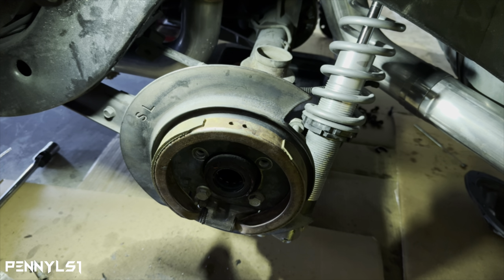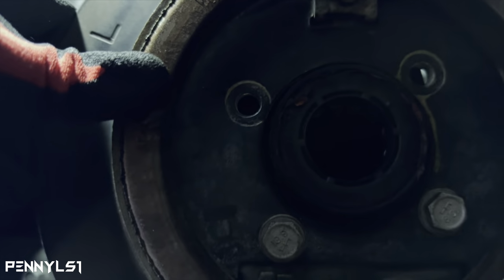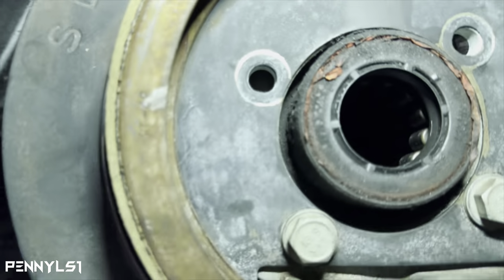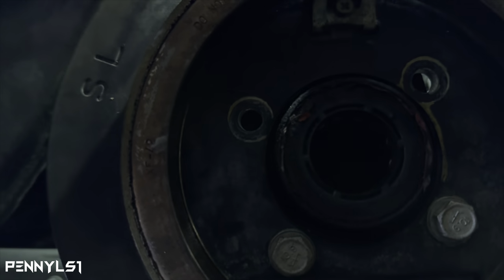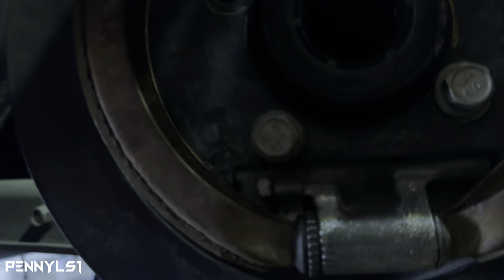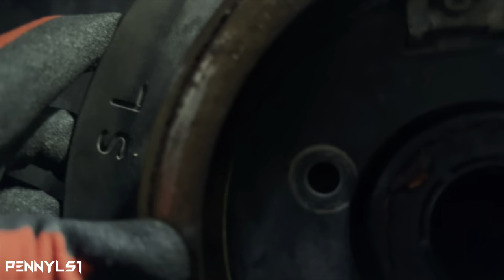Okay, so let me bring you down here real quick and show you what I'm talking about. Okay, so you see how you can see the light coming through the top hole? That's the edge of the, hold on. Drop my light. That's the edge of the, whatchamacallit? Oh, you can't see it now. Let me put it back up here. See the light? That's the edge of the actual flange. So what I did is, see how you move it over? See the edge, you want to make sure when you drill that hole, you want it over as far as you can get it. It's still going to be close, but you don't want to see no light through there. And then the same thing over here, you can kind of still see some light.